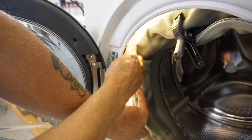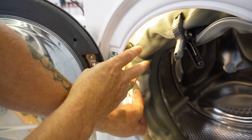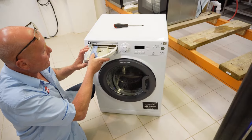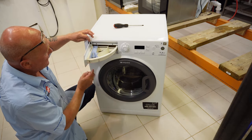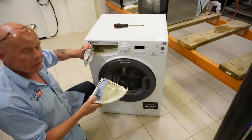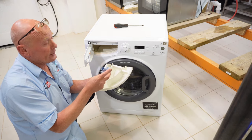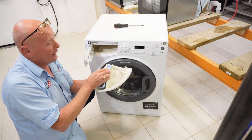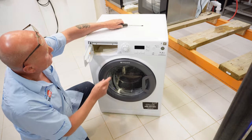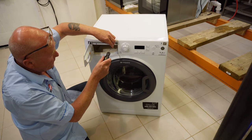If you look down here you can see the water has been tracking from the soap hose - it's either dripping from the attachment at the top of the soap box or from the hose at the bottom. The first thing we need to do is remove the soap drawer insert. On these you need to be careful because the pin can be a problem and the plastic can get brittle, so slide it out while holding it. It's well worth cleaning your soapbox, especially the siphon system.